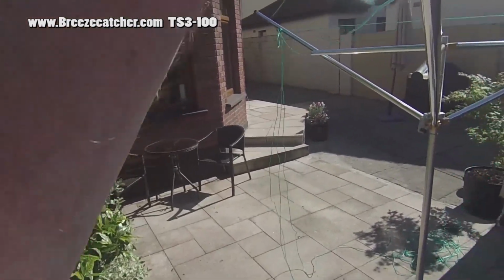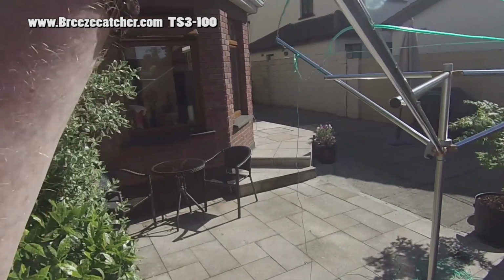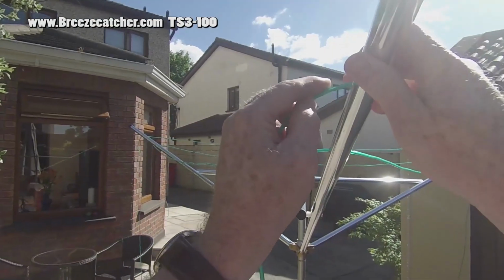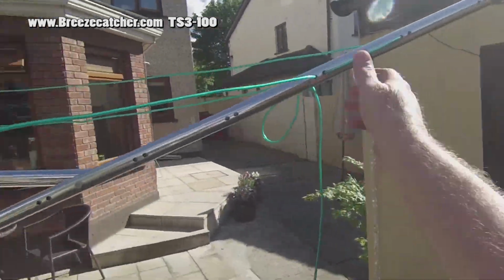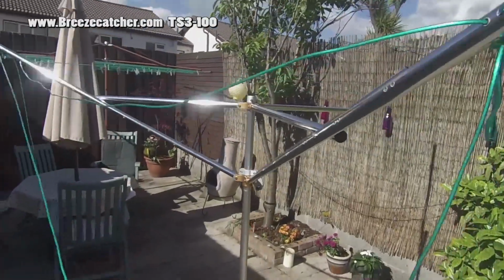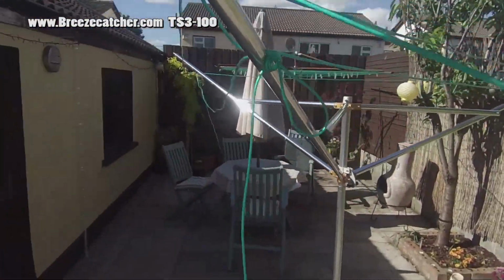When you wire the clothesline, the tip is to hold on to the end of the clothesline as you wire around the dryer. This will prevent any knots and tangles developing. Now wire through the other two sections back to the feedback arm through the top eyelet and pull all the clothesline through.